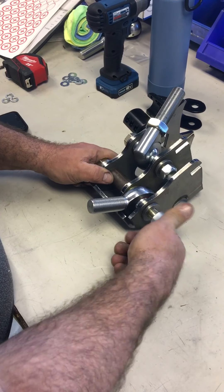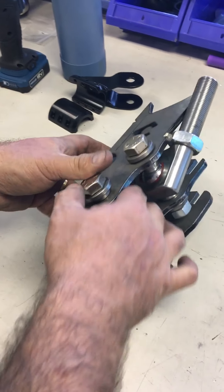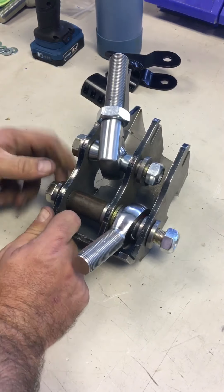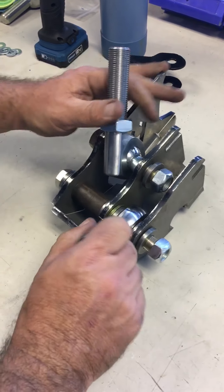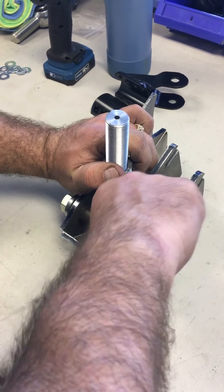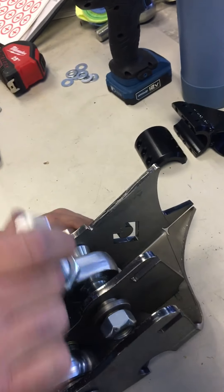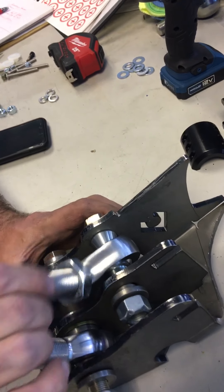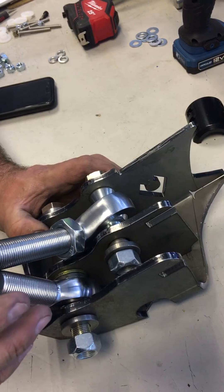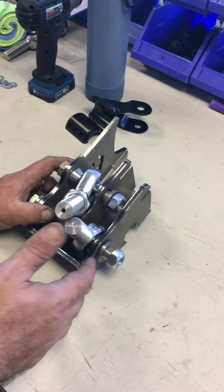Fine threads again. This needs to sit down in there and seat — it'll seat as we tighten it in. You could have pre-seated that. You'll notice we have very low misalignment on our tie rod, very low wobble, and then our drag link is a full 2-inch high misalignment spread, giving you a full 2-inch spread of high misalignment for travel in the suspension. That's how to assemble this. We'll also send some pictures in the instructions. Thanks, guys.